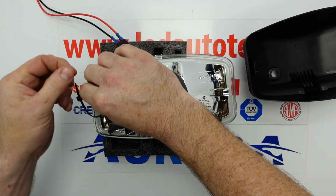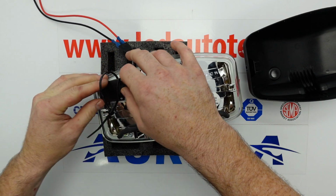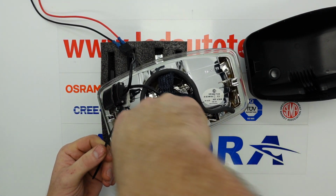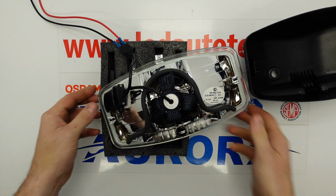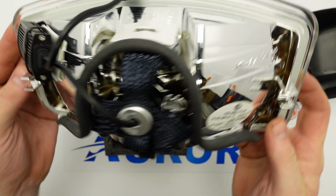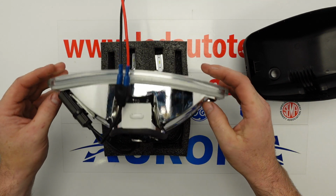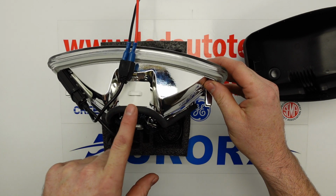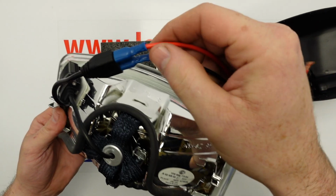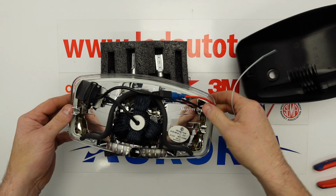And pop it in. Just snip off the excess. So that's the next step. That's just my way of doing things. I think it's just a better job when you go to install it. You're not having this LED driver moving around. The next step I would suggest is on these Headlight Jumbos, they actually have a recess here on the very top, which makes it ideal for connectors, especially in some cases where you'd have a loop in, loop out. So I'll just use a smaller cable tie for this one.